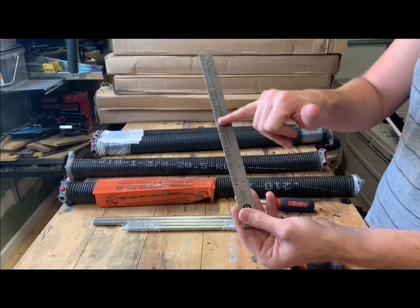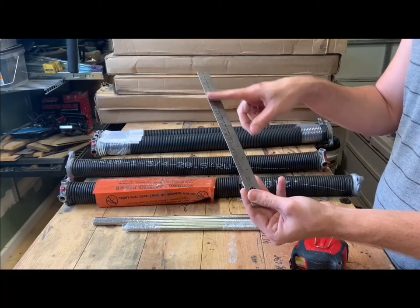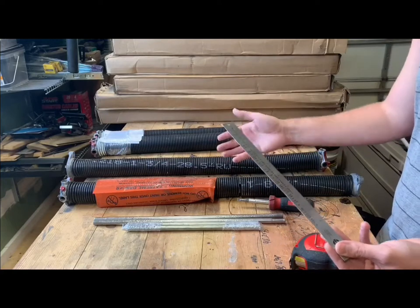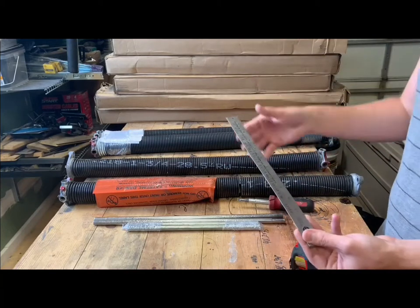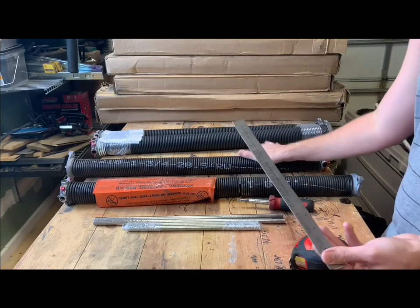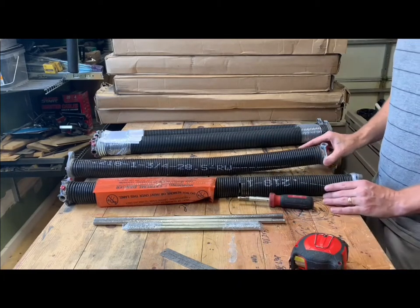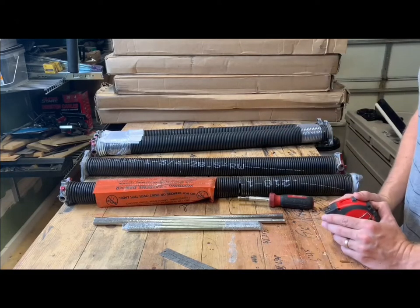You can see the space differences between springs when you count 20 coils — keep in mind the measurement of a spring wire is in thousandths of an inch. A 218 wire means 218 one-thousandths of an inch. A 250 wire is basically one-quarter inch, and a 500 wire is a half inch. The difference between a 207 and a 218 is just 10 one-thousandths of an inch, so you probably wouldn't be able to tell by the naked eye — it's usually about every three wire sizes that you can visibly see the difference.